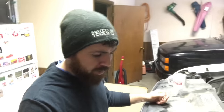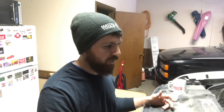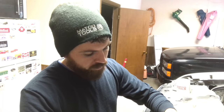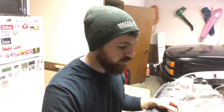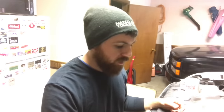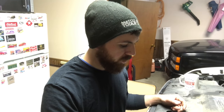Just working on a 2010 Silverado here today, fixing a common issue. It's got the 5.3 in it — driving down the road, check engine light came on, dropping oil pressure. Most people think their engines are done, but there's a common issue with this little guy, a screen that sits right underneath the oil pressure switch on the backside of the motor. These things get all sludged up and carboned up and don't allow the oil pressure switch to read correctly, telling the computer it's got low oil pressure. The gauge drops down, your check engine light comes on, and you get an oil pressure code set.